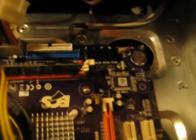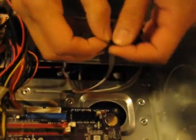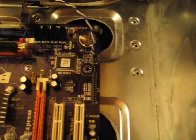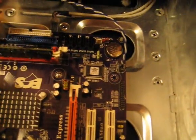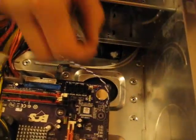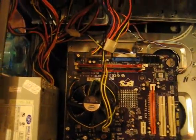We're going to hook up the power. There's a reset and there's power. We're going to hook it up to the motherboard — the power goes right here. Most motherboards come with a diagram, so you just follow the directions. We have a little diagram right here. Plug this in here. And we have our four-pin for the CPU, connecting to the motherboard.